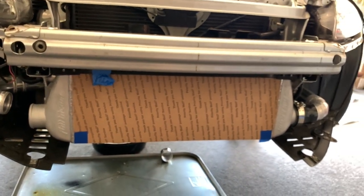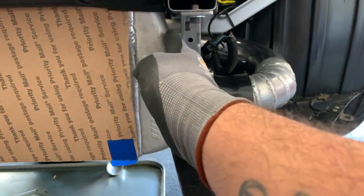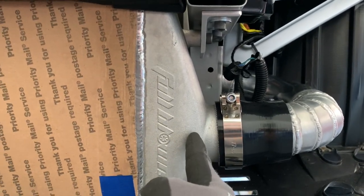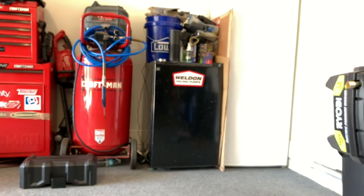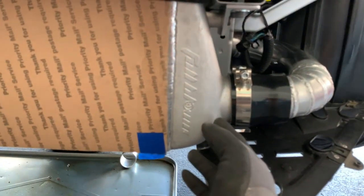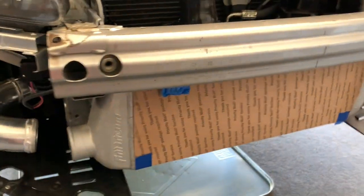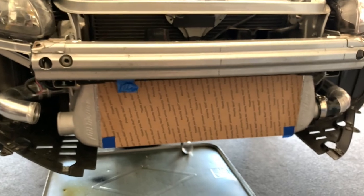No trimming in the bumper, keeping the stock grille. One thing I will have to make though — they don't tell you this — is a center shroud. It creates a tunnel effect so air flows through the intercooler. The stock shroud stops short because this intercooler is pretty wide, so I'm going to have to fabricate a custom one from a sheet of ABS plastic — about a four-by-three piece — to create that same channeled direct-flow effect. I've run it without one and it's fine, but I live in Florida and it is extremely hot.